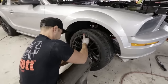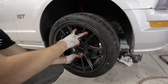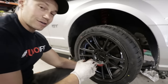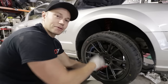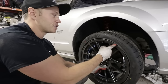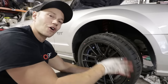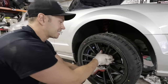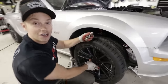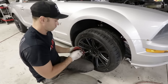Let's mount this wheel up. Check this out — it's got two valve stems. Do you know why? Because if you're a race car baller and you want to pump your tires up with nitrogen, you fully purge the system: bleed it out on one side, let nitrogen in the other, then close it off — and it's all full of nitrogen. We run nitrogen because it doesn't get affected by air temperature as much as oxygen does, so you don't get as much PSI creep.